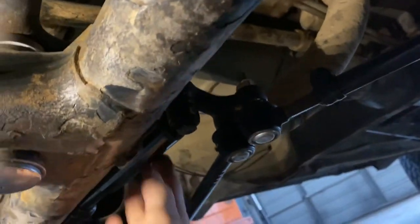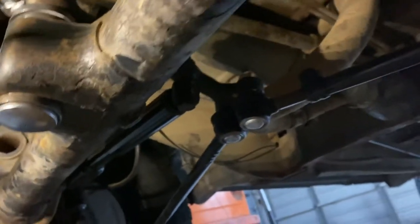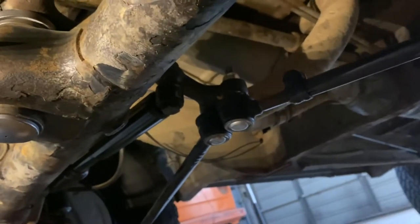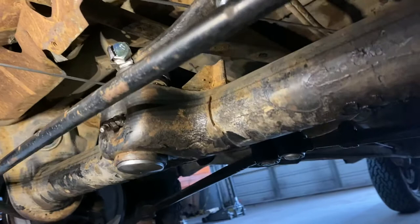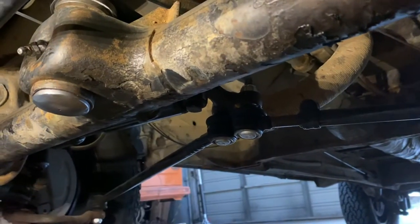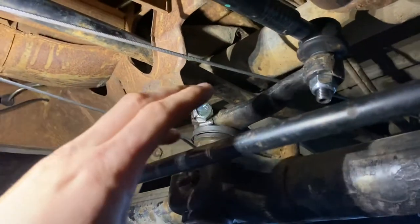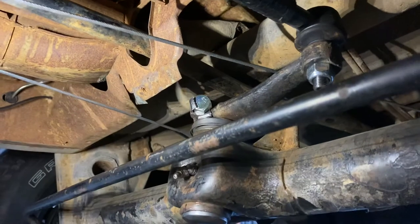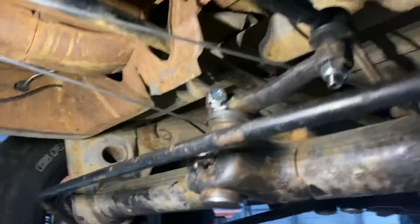The drag link is connected back, as well as the steering damper and tie rod assemblies. Now, as I showed in the earlier video, you don't actually have to disconnect these items on the swing lever. I did because I cleaned up the swing lever and those being new assemblies, they were very easy to remove and install. A lot of times you'll see the disconnection at the top of the swing lever to the center pin, and people will use bungee ties and zip ties to pull the swing lever assembly back.